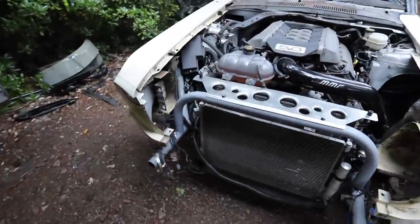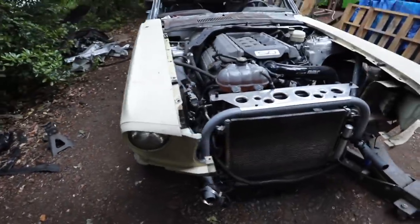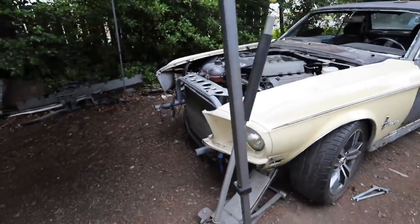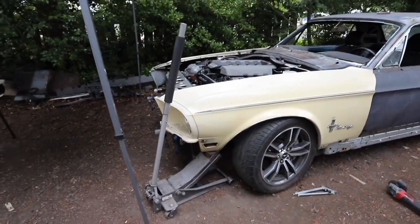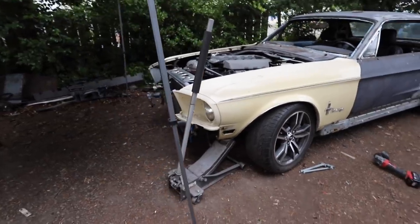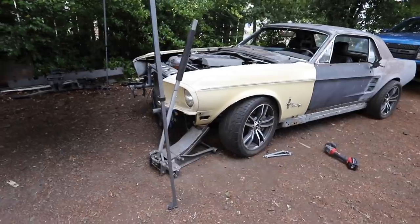The hood will show us what our width needs to be when we come all the way out front, and then we build mounts. We made this mistake last time, so rather than measuring the hood, we're just going to slap the hood on there. Got to go ahead and trim another fender up, get it placed on. Got the second fender on here - it's starting to look like a car. Now we're going to go ahead and test fit the hood. That'll tell us our measurements and then Oscar and I can start building some brackets, get some brackets welded in here, and that will fit the fenders. This is so cool - it is very quickly evolving and looking like a car.